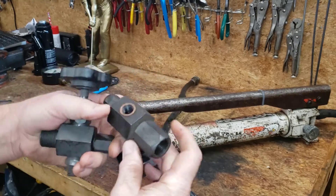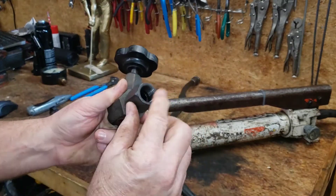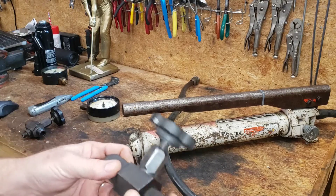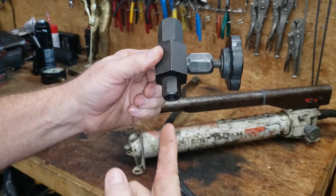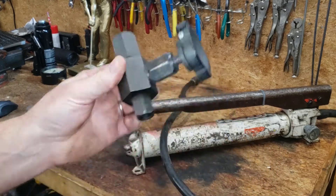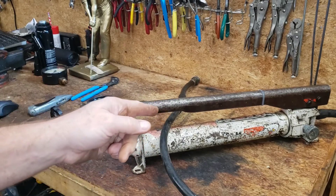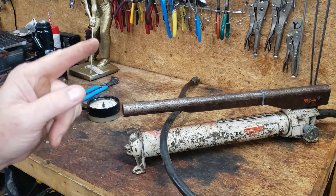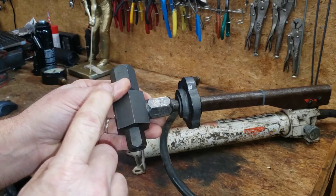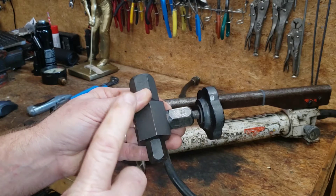When I bought the gauges, they also came with these handy shutoff valves, which already have the T built in — so I shouldn't have to buy any additional T's. The big end screws into the pressure gauge. The hydraulic hand pump feeds in here, the gauge sits on top, and the line going to the injector comes off this side. I may need a couple of adapters, but if the pump works I won't need much else except for the high-pressure diesel line — I'm planning to buy some used Mercedes OM617 diesel high-pressure lines.